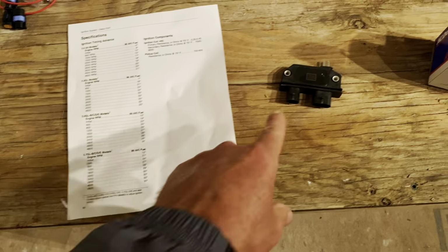All right, so let's talk about these curves. You can see that the 3-liter 4-cylinder engine curve has what's called an initial setting of -2. That initial setting is what you set the distributor timing to by rotating the distributor. You loosen the distributor hold down clamp and use the set timing tool, which is this. Here's my set timing tool. It's got an alligator clip on it for clipping onto plus 12 volts. And then this tool slides into the distributor, goes in this plug here.